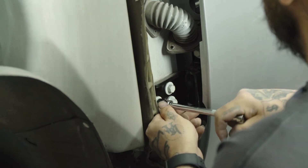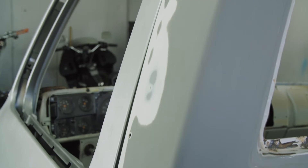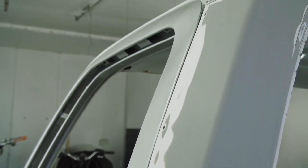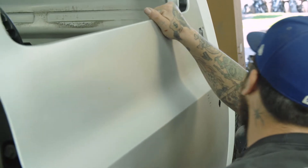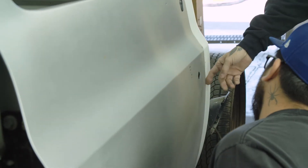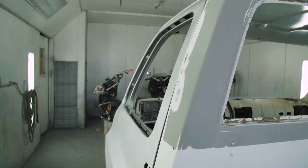Ultimately, it's in their best interest to pull the fender off if they're changing hinges. It seems like it's sitting in pretty far, but that's because there's no weather stripping in, right? Exactly. But just moving that hinge a little bit — it's right where it needs to be pretty much. You're at a good eighth of an inch, which is what you want, right? Exactly.